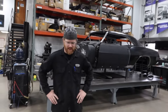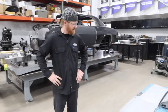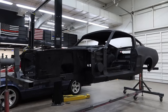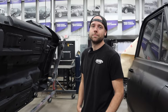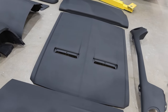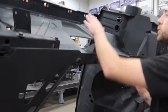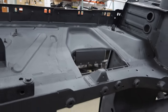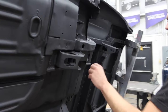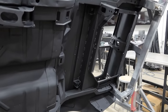Some of Roger's Mustang came back from blast yesterday and we're getting ready to put it in epoxy so we don't get any rust on it. The body's over there right now getting epoxy laid on it. She'll be in the body shop soon and getting the paint process started. So we just got Roger's 1968 Mustang back from media blasting — they did a very nice job. Now putting some epoxy on it. Looking at the underside, we've got a lot of DSC goodies here — modifications made for our Luma frame, shock tower delete panels, subframe connectors, and tie-in to the upper bracket for the quadrilink. The rest of the quadrilink, finish track bar, shock mounts — fab is complete on the car and we're going over to bodywork.